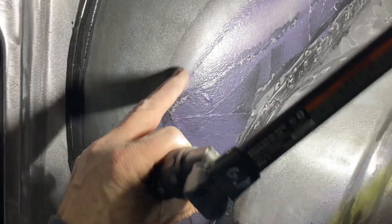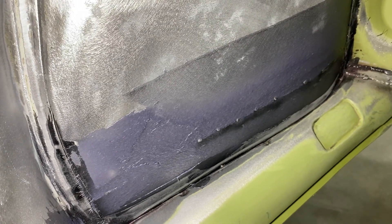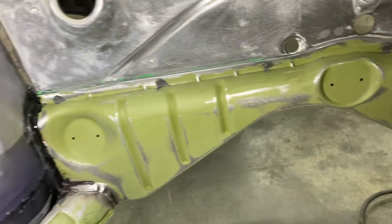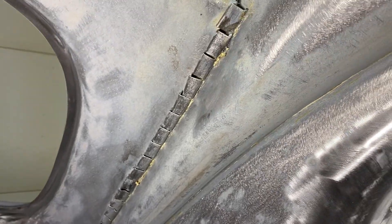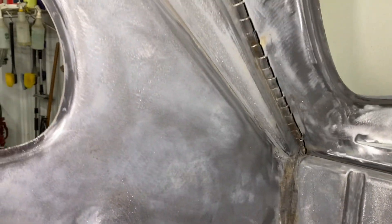So if somebody pulls that carpet up it'll look like no body work was ever done there. Same thing up here — I just wanted to get short strand fiberglass on there to help protect my body work and the metal work from moisture. I feathered out some stuff on that firewall, so that's all gonna get body work in these four corners — the two front and two rear — and then everything's gonna get seam sealed. I cleaned up all of it; it was a lot of work getting all this stuff off. I'm gonna straighten out all those tack strip grippers before I epoxy prime all this.